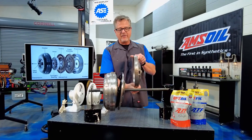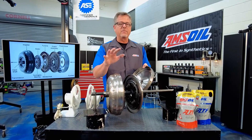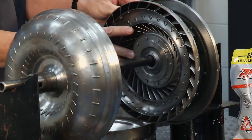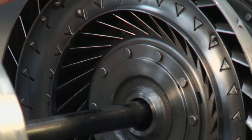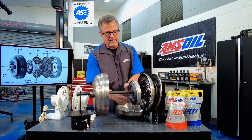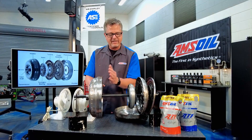Here's the actual cover that's bolted to the flywheel, so this is spinning. And this is a lock-up converter, so this would actually lock up and give you that direct drive one-to-one after it's done multiplying all the torque, and you just need speed. The first piece right here is the turbine. If you look inside the turbine, you have these fins, and these fins either rotate the fluid in vortex or rotary flow — and that's going to multiply torque. It's going to hit this stator, and the stator then redirects the fluid. This is a one-way clutch — it locks up in one direction and freewheels in the other — directing the fluid over to the impeller, and back around we go from the stator to the impeller.